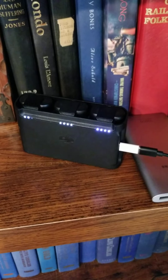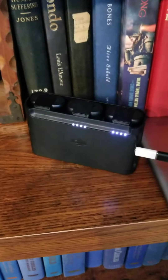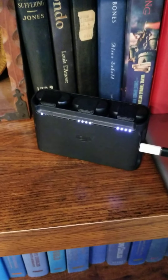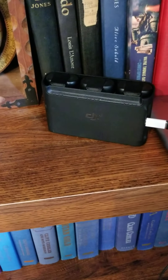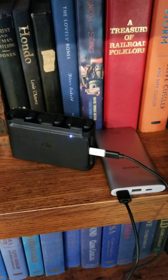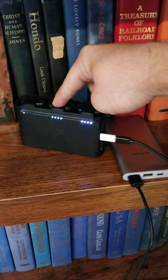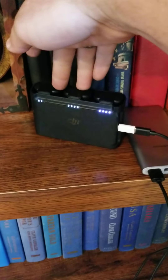This charges at three amps at five volt and for some reason it thinks it's fast charging, and it works great. Say this battery is fifty percent and this battery is sixty percent — it's going to charge the sixty percent battery first because it's closer to being full.